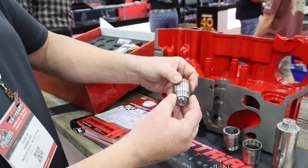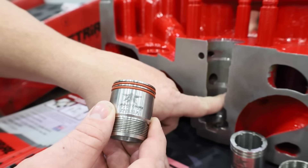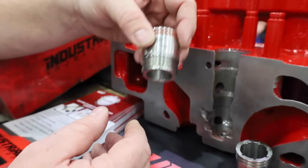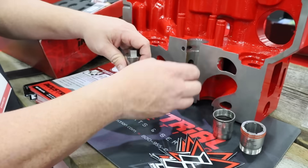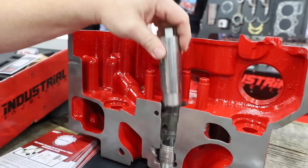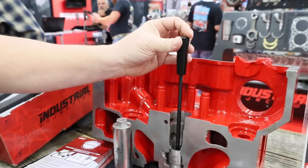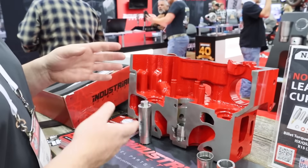What we've designed threads in and locks into the bottom of your bore. We also have a much better o-ring seal on the top end. You lube this up with oil, put some anaerobic sealer on it, then thread it down in. It comes with the tool to lock it in, and you torque it at 55 foot-pounds. Then pull the tool out and do that on all six. Drop your rod back in, pull out your plug, and you're ready to put the injectors back in and put the top end back together — your cups aren't leaking anymore.